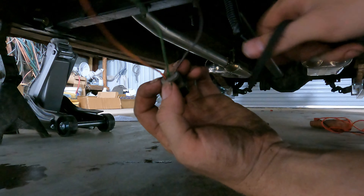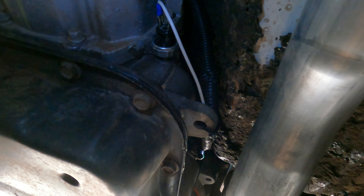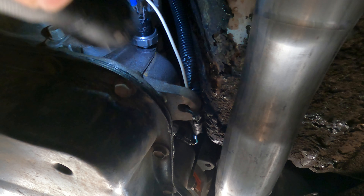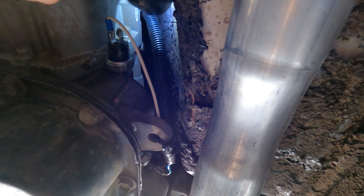So front wire is overdrive at 50 PSI, middle wire is positive running from the key switch through the vacuum switch to the middle harness, and the rear wire runs over to the 52 PSI lock-up switch. Now all I have to do is connect my power wire, get this all loomed up, and then plug it in — we should be good to go. It's all done up, loomed up, looking professional. It plugs in right up here, right where the neutral safety switch is — it's right above it.